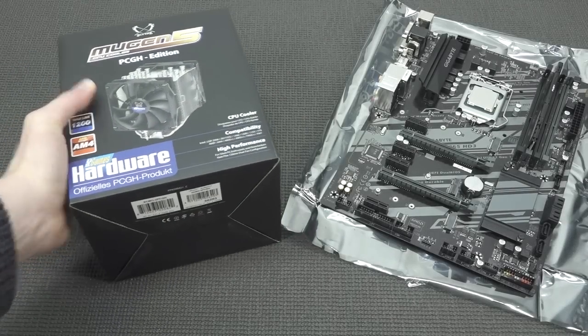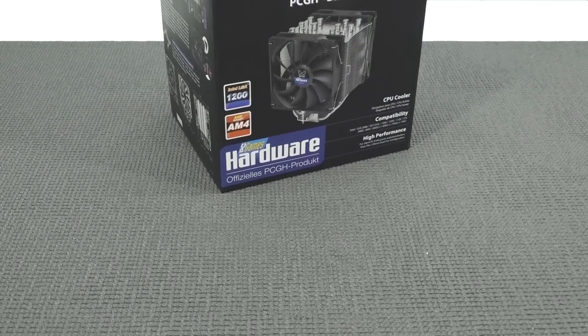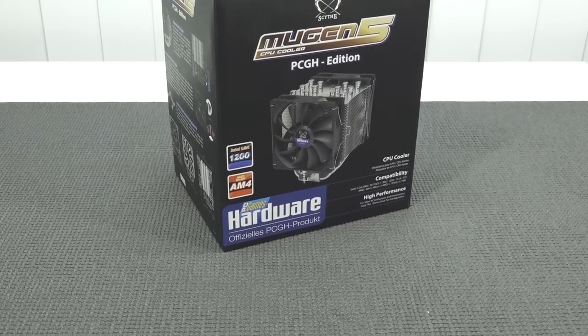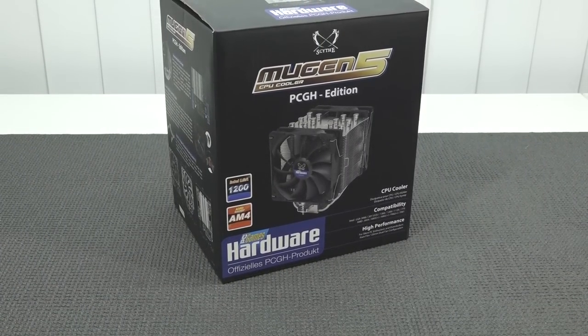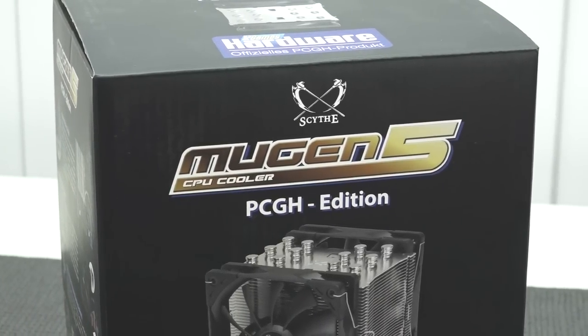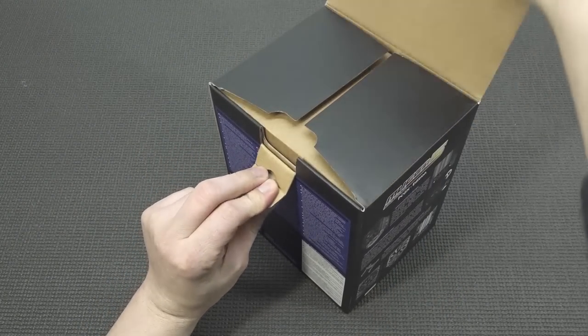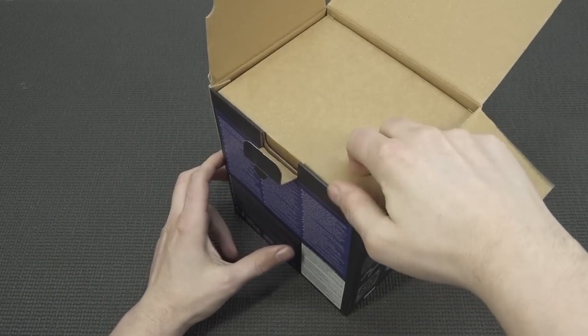Alright, so I'm going to use myself a bigger CPU cooler, because I have this addiction of big CPU coolers and fans. For the i5 I'm using, it's going to be completely overkill, but I'd rather have a cool CPU that will run for years and years to come than a CPU that's throttling because it's getting too hot. So it's going to be quite an investment.